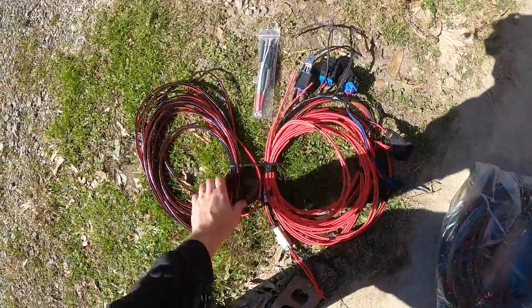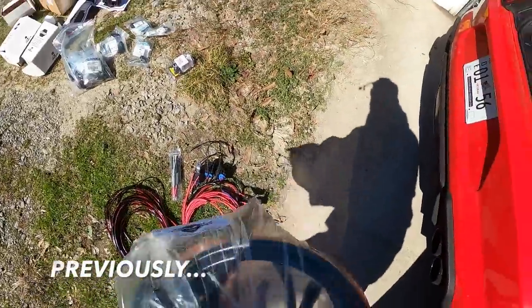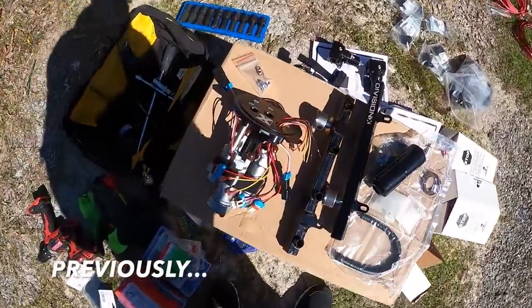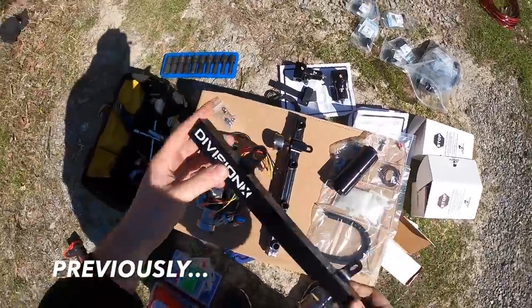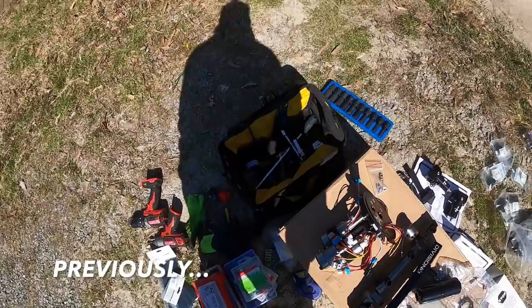You see these relays — everything is pretty much good to go, already assembled for you. The cool thing too is there's already fittings on all your lines. True garage install. But here's the triple pumps, 295s. Look at these new fuel rails — these are super fancy. Division X. There's a filter. Regulators, two of them. So you're going to regulate both sides.